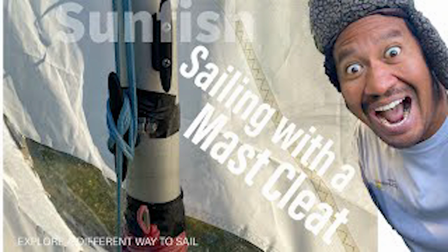Now, the 8th thing that you could upgrade on your boat in 2024 is a mast cleat. Now, why would anyone want a mast cleat? There's a couple of reasons, especially if you use a two halyard system. A mast cleat is very, very nice to have, because you could lift up your sail, you could cleat it off really quickly right on the mast, and then you could use your other halyards if you want to.